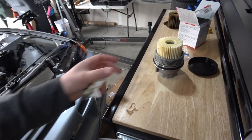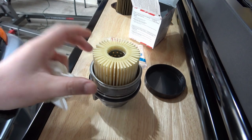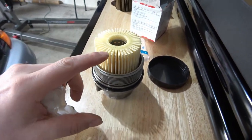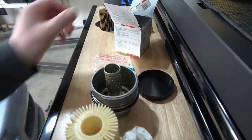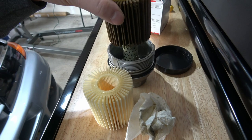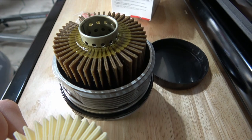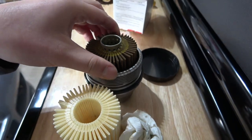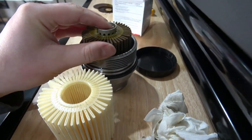I'll throw this in and get back to the video. I've got the new O-ring on, and it's important to have the proper length oil filter. If it's too short, like the other one was, you end up with gaps where the oil is going to be able to bypass the filter — therefore your oil filter is not really doing anything. So if you bought the A1, make sure you get either the A3 or the A5. I'll have a link in the description down below for the proper A3 filter.